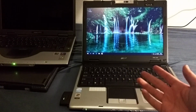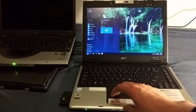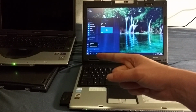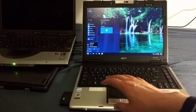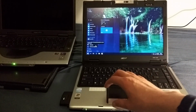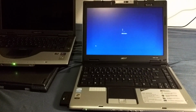So yeah, has GMA 950 graphics, so that's why I could actually run Windows 10 on here. A lot of laptops from this era had pretty much the graphics that the Compaq has, you know, Radeon 9000 series, but not really the good kind that could run Aero. Or they had GMA 900, which could not run Aero either, or whatever you want to call it.